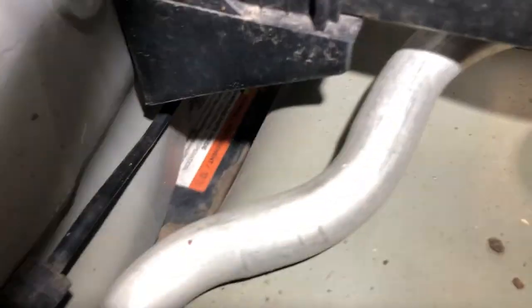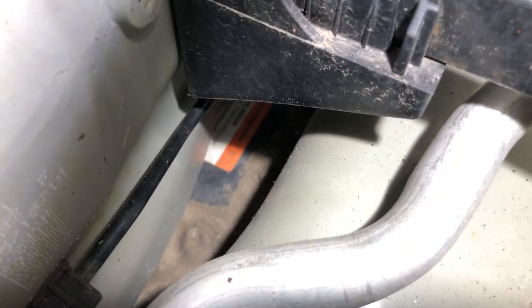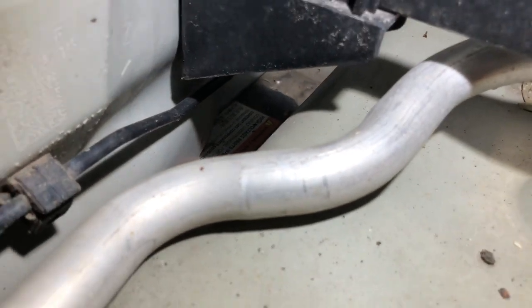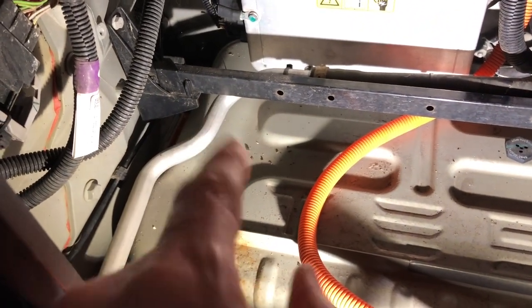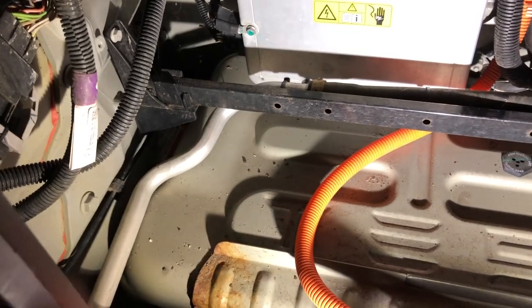You see that bright warning label down there? And you see those bolts — they're all slathered in sealant. Underneath that is the main fuse, and that gets water ingress into it fairly regularly on the old packs. There is a stainless one available from some aftermarket people. This is a replacement from when mine leaked a few years ago — they dried it out, put it back in, said it was good to go. This is still the original battery pack on this nine-year-old car. This is much better sealed than the original was; I've seen some really horrific rusty plates there, and it's no wonder they leak. I'm going to clean that off and maybe put a thin layer of sealant on top just because it's convenient.